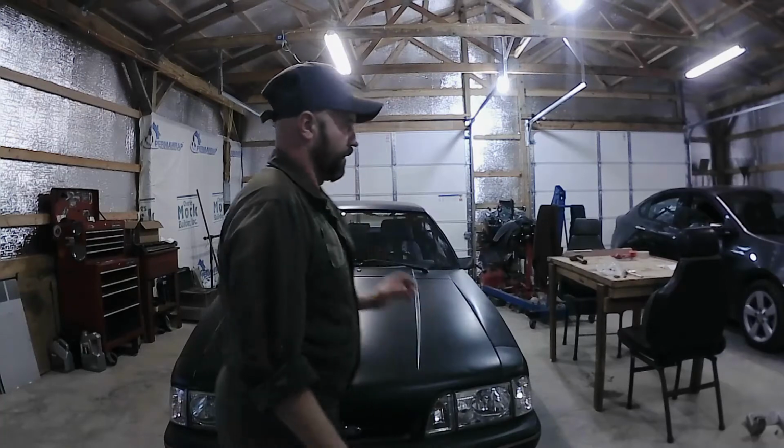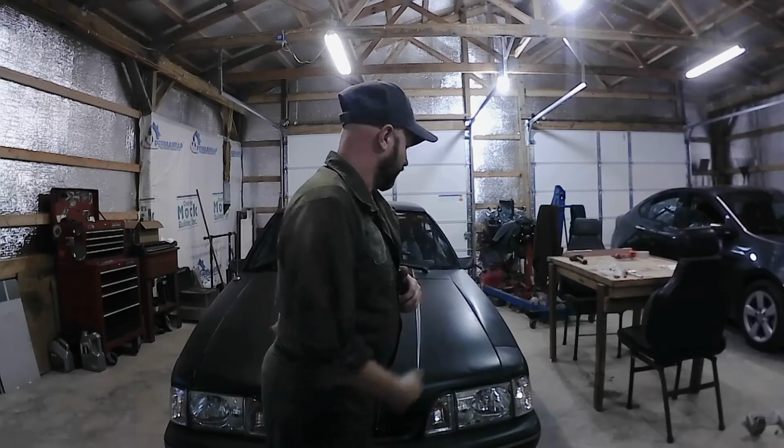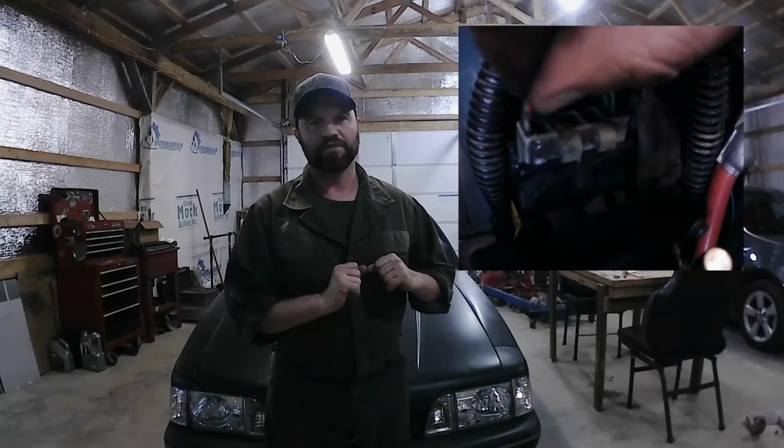But I also need to address the worn out clutches in the rear end, so I actually have both tires spinning or whatever they're going to do, right? And then make sure I do my carrier bearings at the same time. So that's pretty much a rear end rebuild. Nothing else major. We did see some of the stuff on my engine while the engine was cutting out, and that was, like I said, the positive coil wire going into the coil. That little clip right there didn't hold it in, so it was backing out. So I don't think I explicitly said that, but here's a little clip you can see of that.